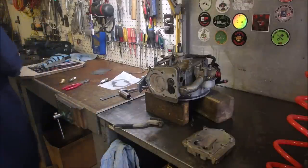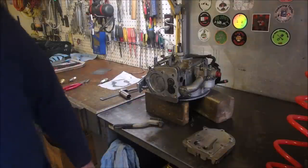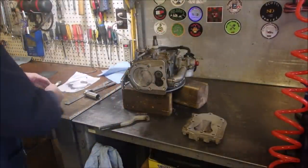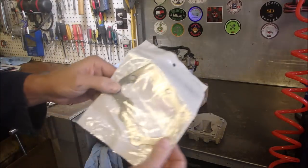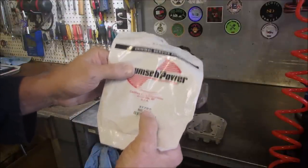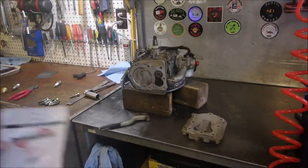Now, head bolts. How many do we need? Well, we're going to need at least that one. 200 inch pounds, right? That's what I said. 1, 2, 3, 4, 5, 6, 7, 8. There's 8. I'm a little nervous about this, you guys, because this head gasket doesn't look that meaty to me. But it is a 37796 for an LV195BA Tecumseh mower. Did you get that?